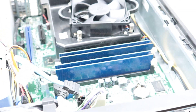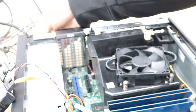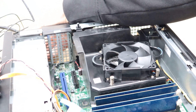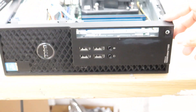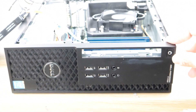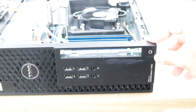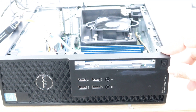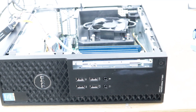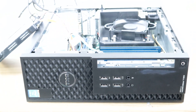Before connecting the hard drive, I'll make sure the computer is working fine. You can also test by adding one memory stick at a time, turning on the computer to check it's working, then adding the next. The good sign is that we now have a white light, not an orange light. I'm going to turn the computer on and see if we get a display on the screen.